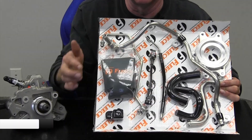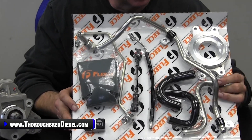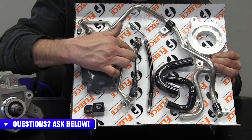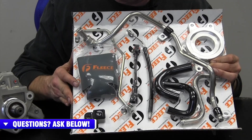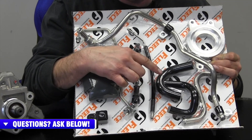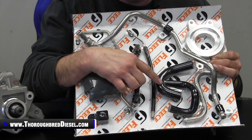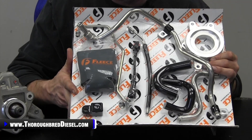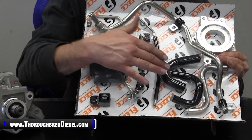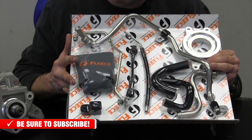Adam is zoomed in here now — this is the new dosing line that's going to be sent to you, and that's going to supply fuel for your dosing injector. This is Fleece's revised kit, and it comes with your wiring extension harness for the CP3 that gives you some slack on that harness, plus the new revised fuel lines right here. These are different angles and a slightly different length, making it easier to have a cleaner install — and with the correct size and shape, you're not going to have the kinking we were seeing in some earlier installations.